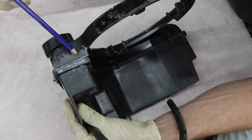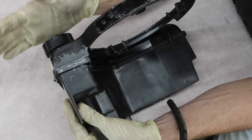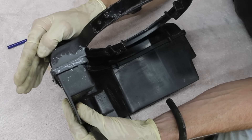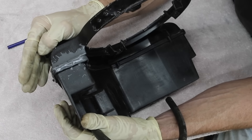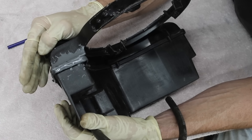I have already pressure tested this tank. The way to pressure test the tank is to seal off the gas cap area where you add fuel, and basically put pressure through where it drains into the carburetor — just add some air pressure to that to see if it holds. There was no more leaking air, so I know this is a really tight seal. The question, though, is can it stand up to gasoline as JB Weld claims it can?